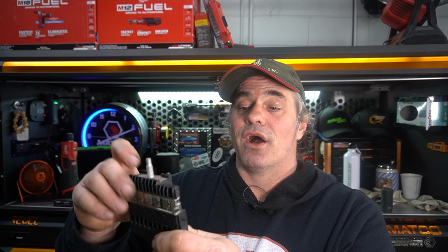Tested on this post, had power. On the circuits coming off of it, I did not. Didn't have power where I should have power that fed the fuse box. So pulled this out, saw it was blown. Talked to the service writer, said we need one of these. Probably still going to need other stuff, but we need to fix this first and go from there.